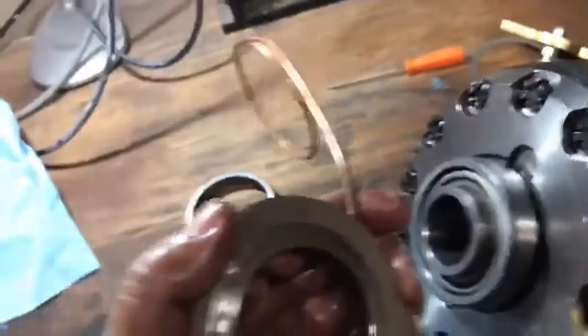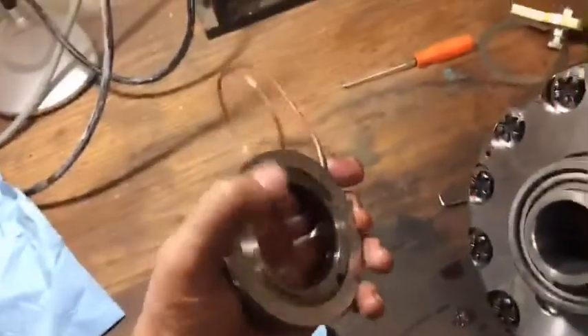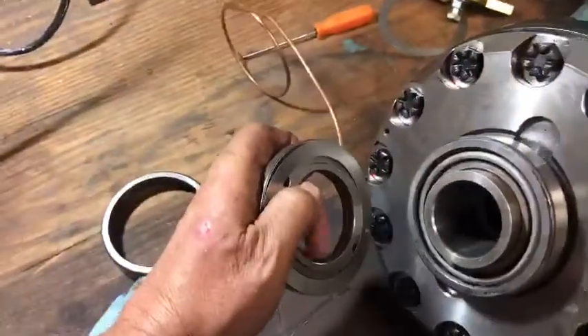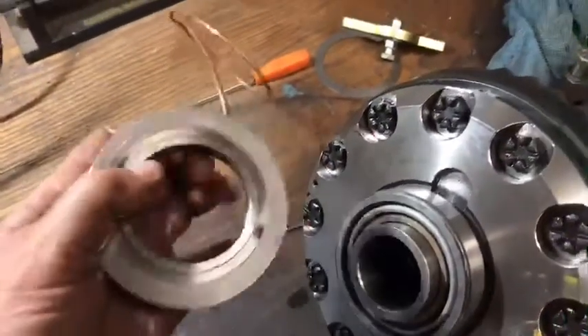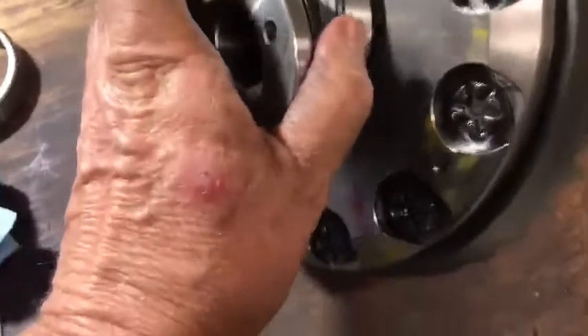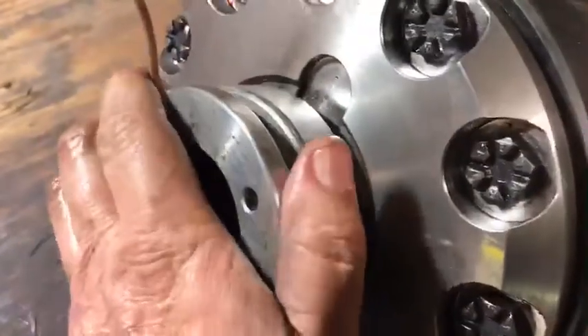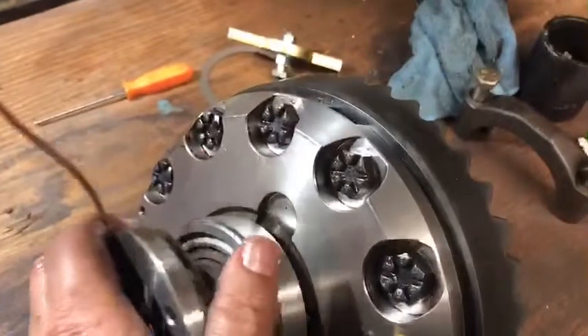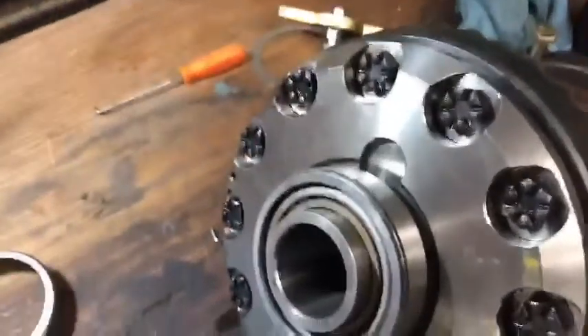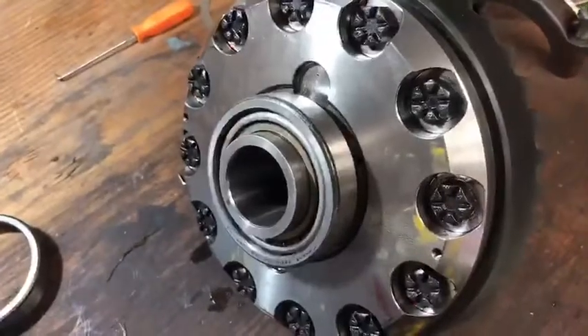Now I'm doing kind of final installation. I've added an extra thousandth shim there, and I've installed the little seals for the ARB in there — that's one of the last things you do. I'm going to put that on there real gently, take my time to get it on there just right, and drop the ARB into the housing.